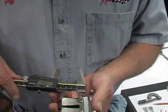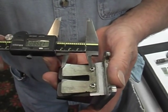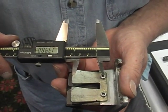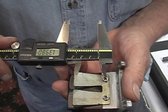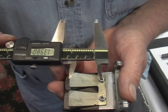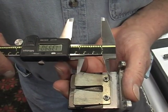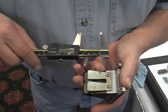What we're doing now is measuring the stop length. You find, as best you can, the center of the stop screw, and you set it there to the edge of the reed stop, and you come up with a dimension with a little bit of twisting. Then you go in and check this reed stop. I've already checked the dimension and it is within compliance. What we would do is inspect the second set of reeds, but we're going to move on for the sake of simplicity.